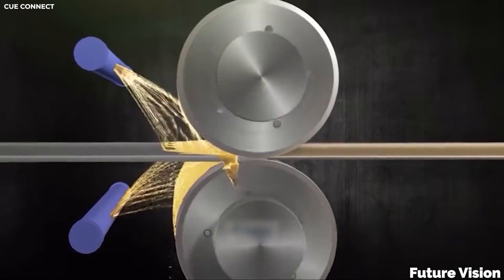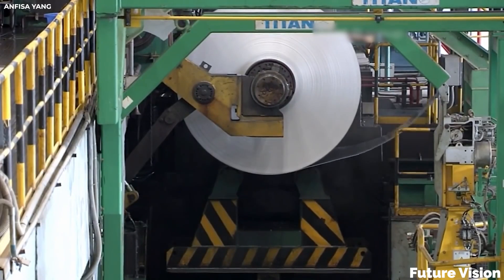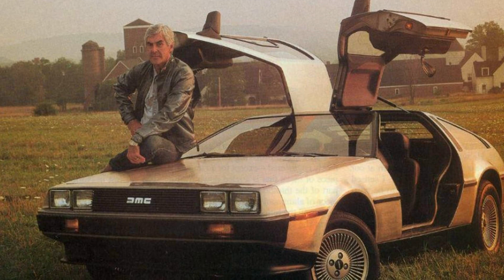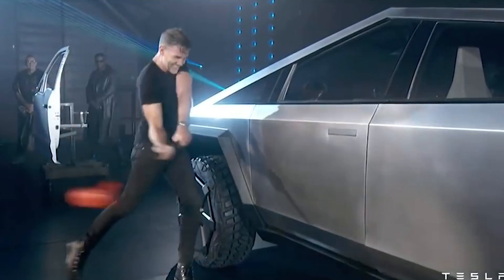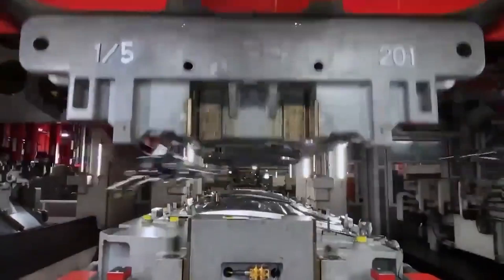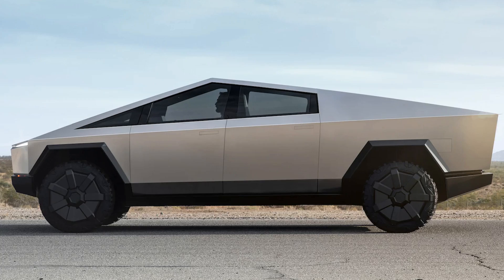We'll have to start off with some material science. The body of the Cybertruck is made from a 1/8th inch thick sheet of 300-series cold-rolled stainless steel. This is not a typical material to build a car — this is totally unprecedented. There was the stainless steel DeLorean of the 1980s, but those body panels are significantly thinner and softer than the Cybertruck material. As we saw from the sledgehammer test at the Cybertruck launch event, this thick, cold-rolled steel is incredibly strong. And because the steel is so hard, it can't be stamped into a curved shape like a regular automotive body panel — it would literally break the stamping machine.